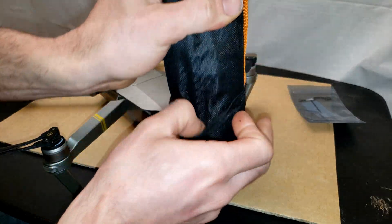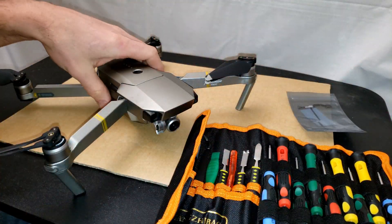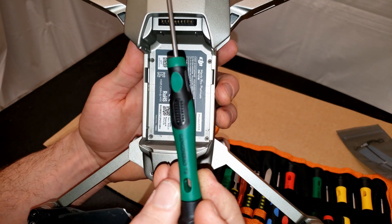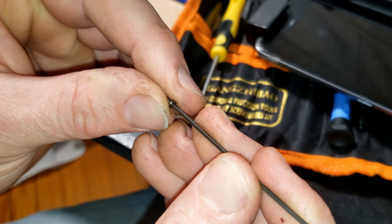Having a precision tool kit like this comes in handy too. I'll drop links to this stuff down below for anything you see in this video. With the battery out, you're going to start by removing these six screws from the case. I'm using a T6, even though they look like an Allen — the proper tool for these screws is a 1.5mm hex.